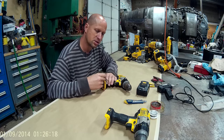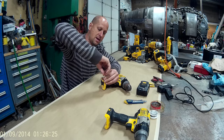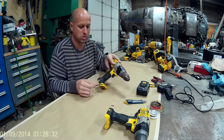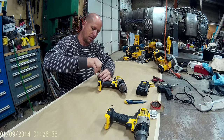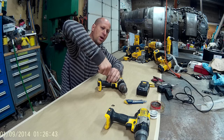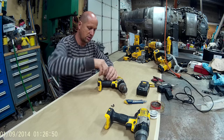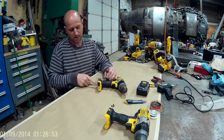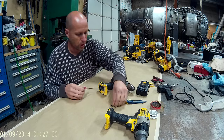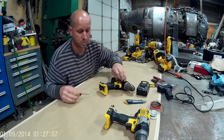Let's open one of these up. Most of these tools are held together with a Torx T10 style screw — kind of small, and you usually have to have one that is a regular screwdriver style and not just a bit, because some of these screws are down inside a counterbore and it would be very hard to get to with just a bit in a bit holder. Sometimes an old-fashioned screwdriver with a handle is the only way to go. I'm guessing we don't even have to take the drill all the way apart, because really what I want to do is pull out this connection block, which has a little bit of play to it.